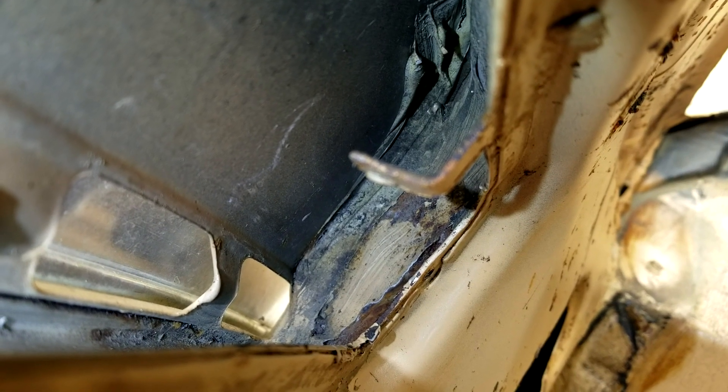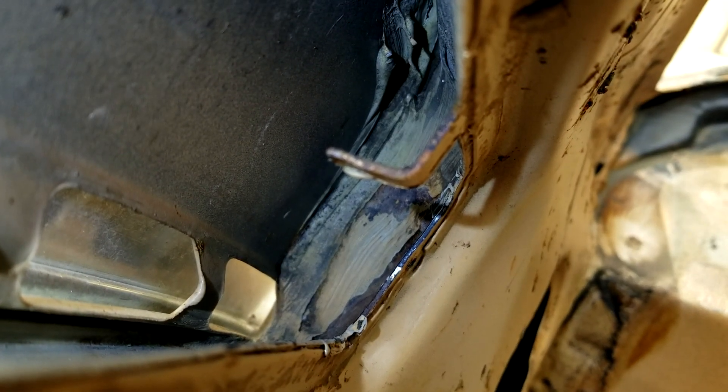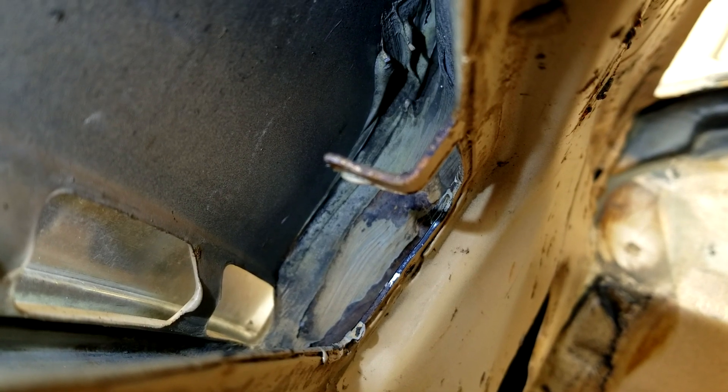Inside here I'm gonna clean this out really well — there we go — and then reseal it. There are a couple little cracks. I got it cleaned out really good with acetone and I can see what I'm dealing with: there's a sealing compound in between the metal panels. Because there was moisture there from that nest, it's kind of peeling up, so I'm gonna do a rust conversion and then apply some body sealer so any moisture will just drop out the bottom hole.